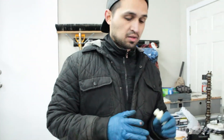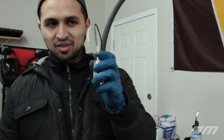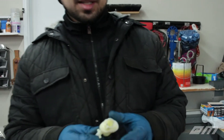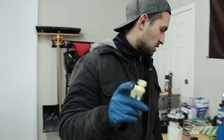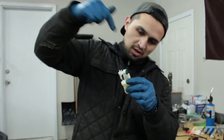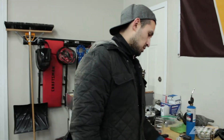We continue to mess around with this thing and we're just about to call it quits. We rigged the old fuel pump in a very sketchy way to the battery next to water just to see how it would work with this Venturi fitting. But we can't get it to work. The problem is this fitting works fine, but we can't connect a three-eighths line or any sort of line to the top of this. We have to use this weird-ass fitting that clicks in like that - and these openings are obviously not three-eighths, so that kind of defeats the purpose of having the return go through here. It sucks up fuel from one side of the fuel tank and dumps it into the other. Radium, on the other hand, engineered that whole thing, tested it, and it works.